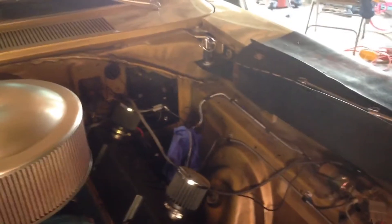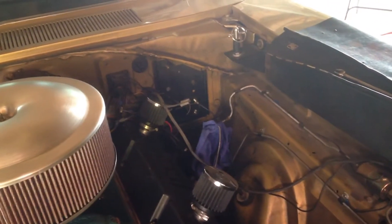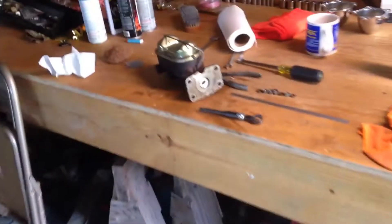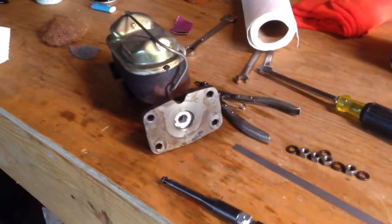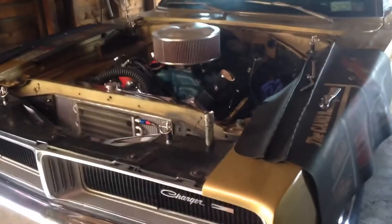Since we really didn't know the ins and outs of the whole system, we removed the power brake booster and the original master cylinder and replaced it with a master cylinder that my father picked out. I'm not really sure how he picked it or what was available at the time, but the car never really stopped good — it was better than it was with the four-wheel drums though.